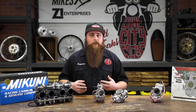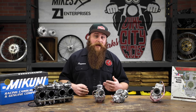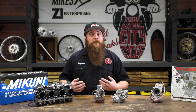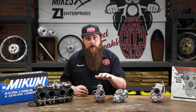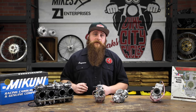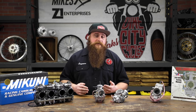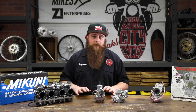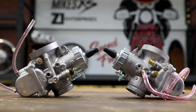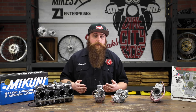Now let's say the last joker who owned that vintage stallion shoved a cheap copycat carb in there just to get it running, but you're ready to upgrade reliability and performance. Mikuni offers different models of carbs to suit all kinds of applications. Here at Dime City, we offer the crazy popular VM round slide carb, the TM flat slides, and the race-inspired RS models. These model designations generally end in a number like VM 30 or RS 34, representing the different bore sizes in millimeters. A large reason these carbs have been an industry behemoth is the fact that they are controlled by actual cables, versus CV or constant velocity carbs that use the engine's vacuum pressure to lift the slide.